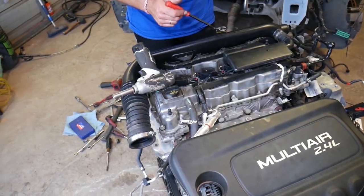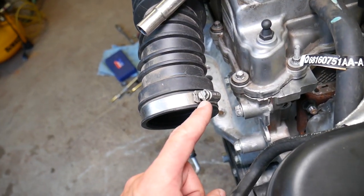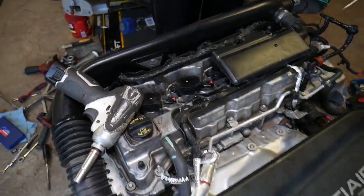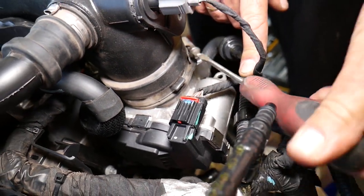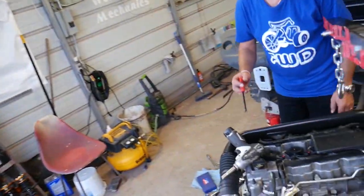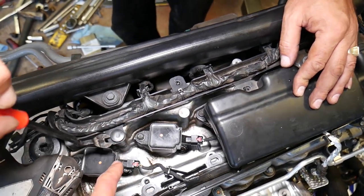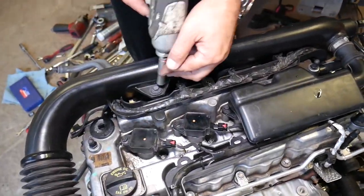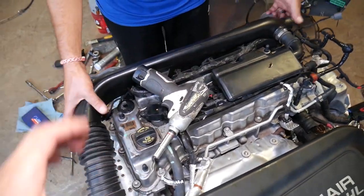Right here you have the air filter box with the holes for the intake. You'll need to get that hose clamp loose and pull the hose out - just unscrew it with a flathead screwdriver. Do the same on the throttle body side. Remove the intake temperature sensor as well. You'll have one clip - go with the clip removal tool underneath and pull it out. Then there's a 10 millimeter bolt holding it - remove it and pull that piece up.